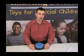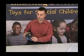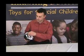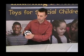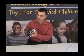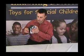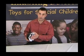The Big Talk Triple Play has the ability to record either a single or a sequential message series. Right now we're going to focus on showing you how to record a single message. So to do that, turn the machine over. On the back, you'll want to turn the machine on, turn your on-off volume control, and you want to select your random sequence single message switch to single sequential. Press the red record button, hold that down, and while holding it down, press the large plate in the front and speak to the microphone here on the side of the unit. Testing, 1, 2, 3. When finished, release both. Testing, 1, 2, 3. And that's all it is.